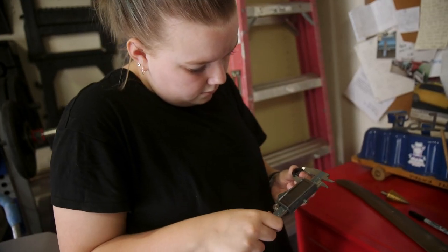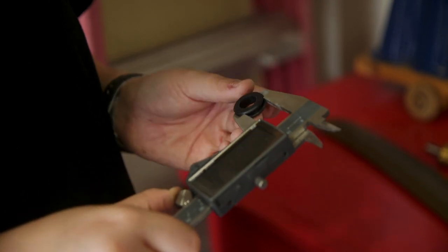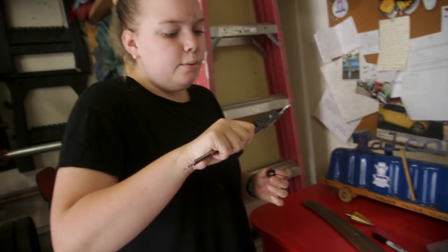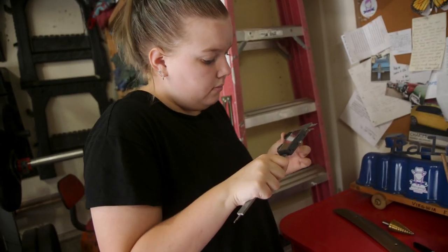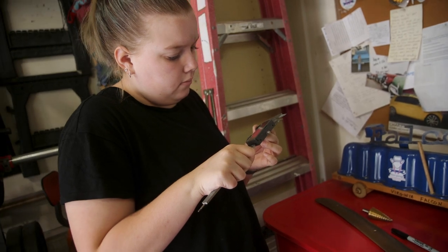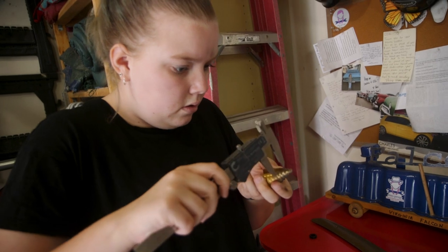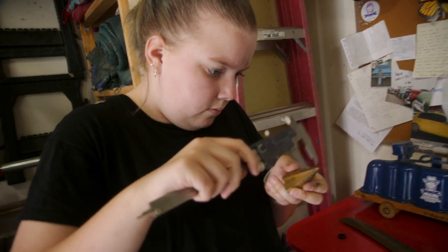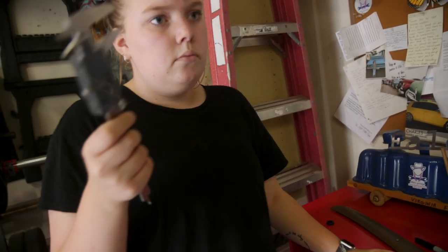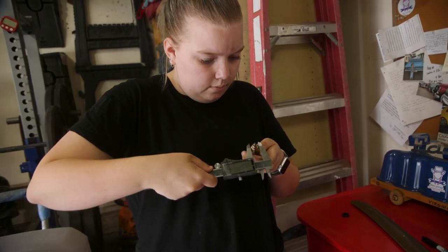To find out what size hole I needed to drill, I measured the actual diameter of the grommet using a digital caliper. What does it say, just so we know? 21/32. 21 32nds. So it's like 10/16ths, or maybe about a 5/8ths. 11/16ths. So what's one below 11/16ths? So it was 10/16ths, 5/8ths. Okay, yeah. So a 5/8ths drill bit, let's see what you got.